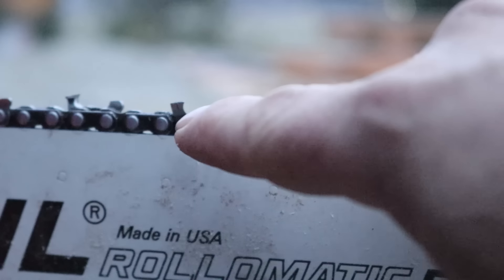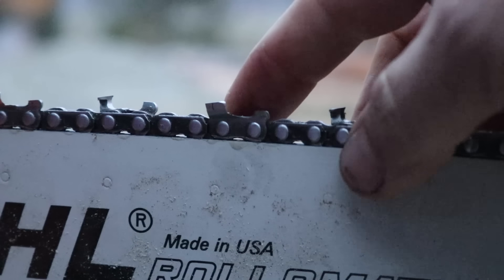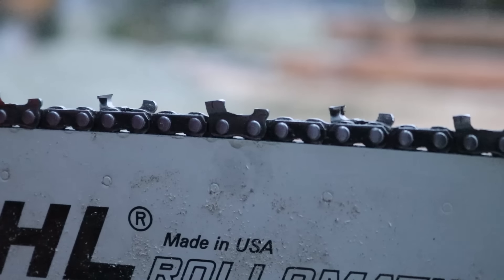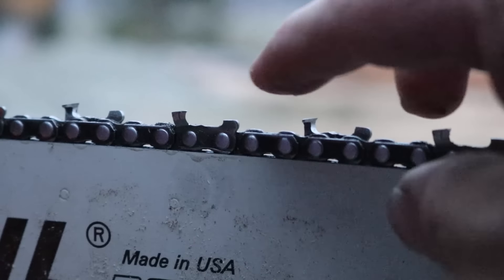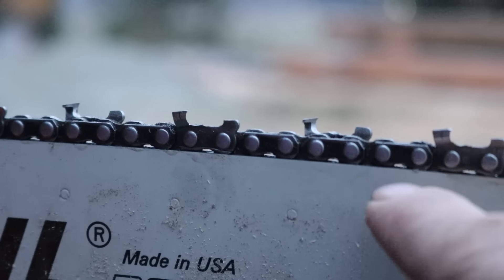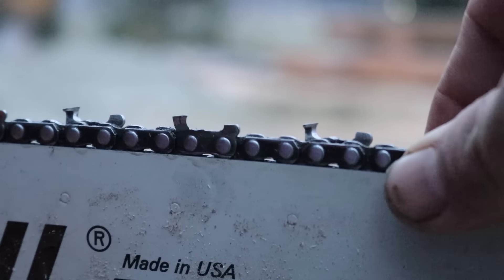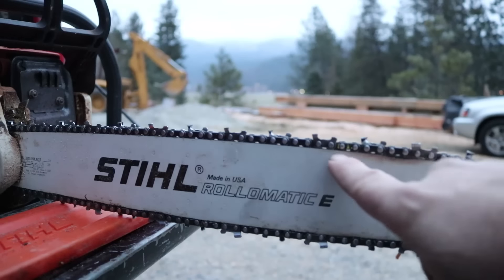Already this tooth is having a much more rounded profile. If we look at this tooth you'll notice that semi-rounded but almost vertical profile, versus the tooth that we just sharpened, which has a much more curved profile. This tooth again has a more vertical profile and on the bottom you can see that the gullet has been riding up instead of being maintained. So I'm going to spend a little time and re-establish those gullets on all of these teeth and then give this saw a test. I have a hunch that instead of getting that fine powdery sawdust, we're going to get some beautiful wood chips.